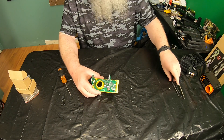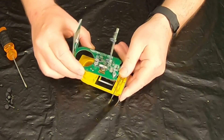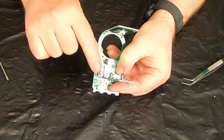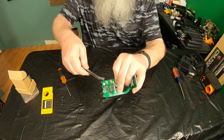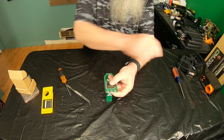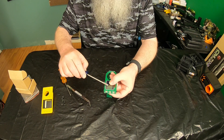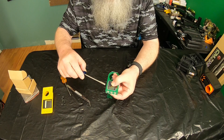What I do is use my tweezers, come over here on the side, and just press gently, and it comes right out. Here's your LCD screen here — it plugs in the back right here. Take your tweezers and just gently pull this ribbon out of the slot. Next, take your flathead screwdriver and put it underneath your LCD screen and pry it off. There are actually a couple of adhesive strips holding it in place. Don't go in at the corners because there are four little tabs right in there, and you don't want to break those off.